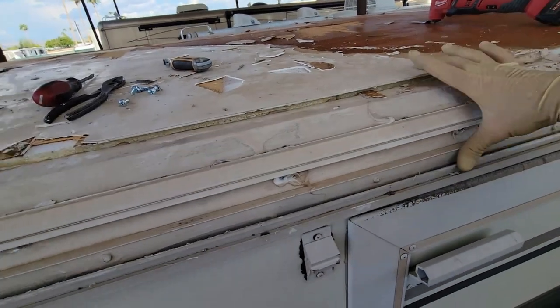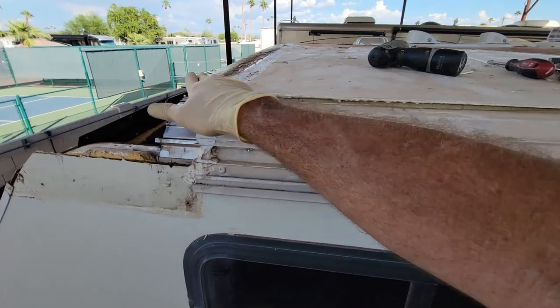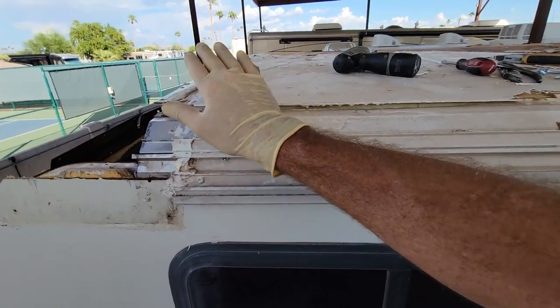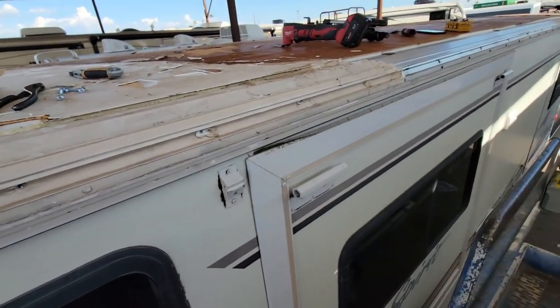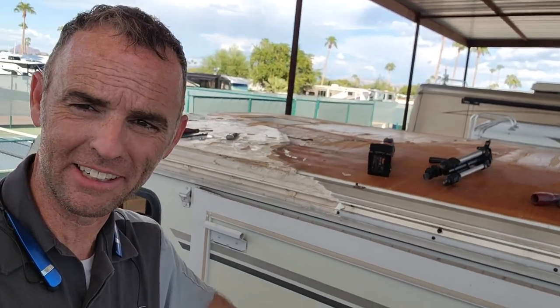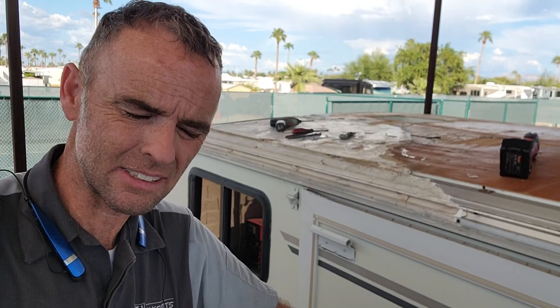If they were gonna do this, they needed to manufacture some sort of a cap right here, seal it down using maybe some Eternabond or some other sort of tape, and then put the coating on it. But they didn't want to put that effort into it. They were just hacking it. I know that's not a nice thing to say, but this is a hack repair. They knew it was a hack repair. It was just get her done repair and hope for the best. It's very disappointing that somebody sold that to somebody else without disclosing it.